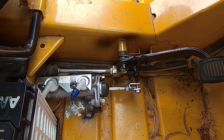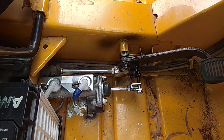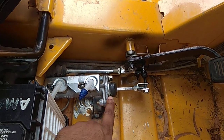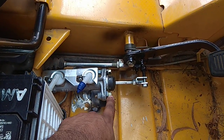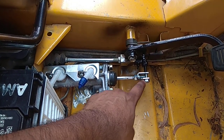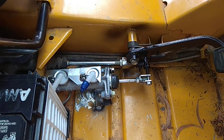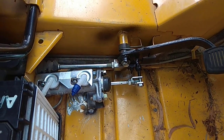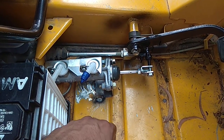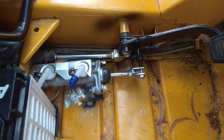Let's see how to double the brake performance of the auto vehicle three-wheeler. For that, additionally we require one tandem master cylinder, which is connected to the floor by a bracket and connected to the brake pedal by one shaft. We can connect this to the reservoir with the existing or one remote reservoir.